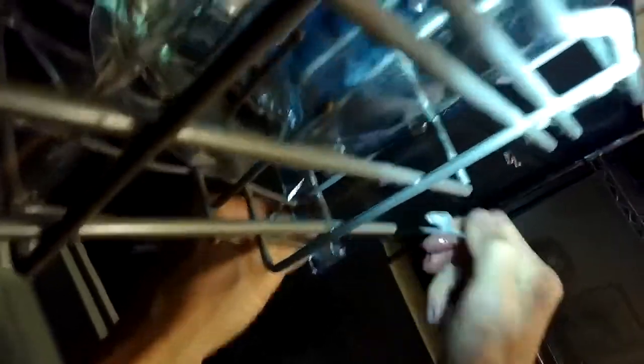This would be a good thing to do about once a year to really keep your dishwasher doing great — probably takes about 20 minutes. Pulling the upper rack out of the way, I'm looking at the same thing on the upper rack: the little holes. I see some of them are clogged, so I'm using some needle nose pliers to pull the stuff out of there.